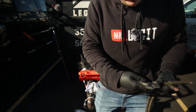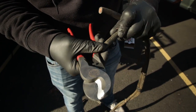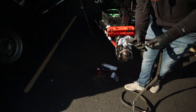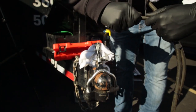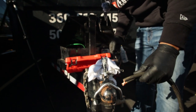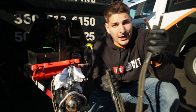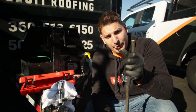I tried to take off the insulation with wire cutters but they're damaged and just chewing into the wire. The wires here are finer than the other ones — a thicker copper wire. I'll use a razor blade instead — cuts right off, doesn't damage anything. Without the measuring tool I'm just going to take this wire down to the auto parts store, which is right down the street, and see which connector size we need.